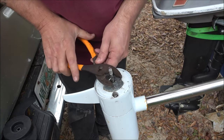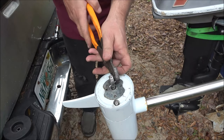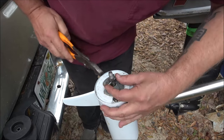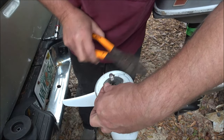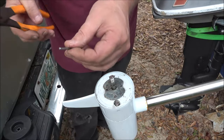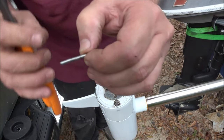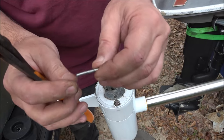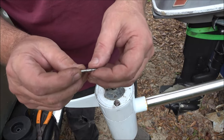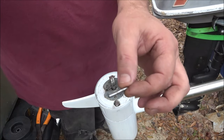Let me knock this pin out of here. Remember it was moving before — now it's not. I've bent it the wrong way too far — no, it's fine. I'm going to straighten this pin out and just won't put it on as tight. I'll still look to see if I can find a washer that'll fit in there. That was bent like an S — I'm surprised it's still holding up from the first time I straightened it. Somebody hit something really hard with it at one time. I had trouble getting the prop off and this was just bent that way and bent this way. Let me go see if I can find a washer.